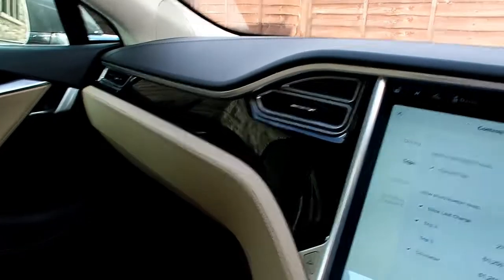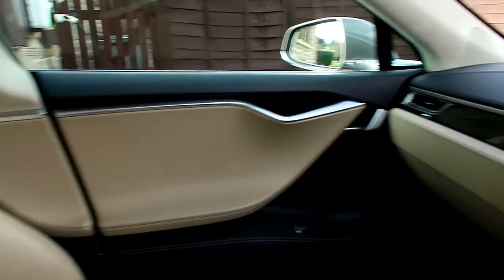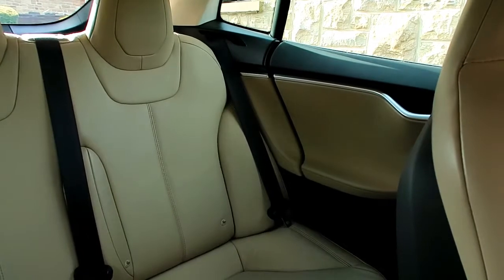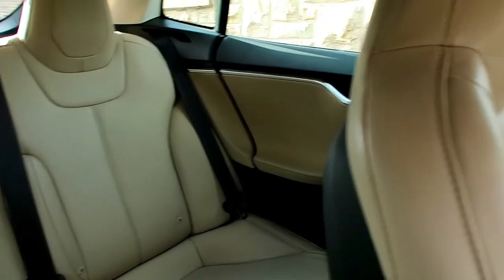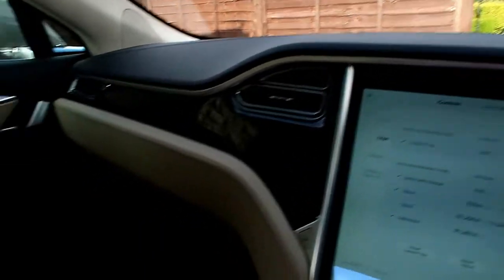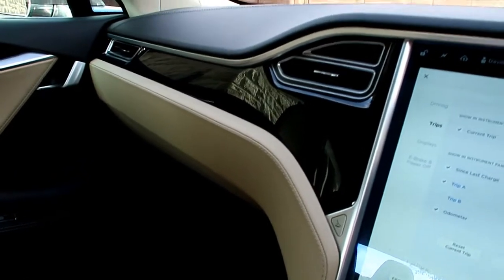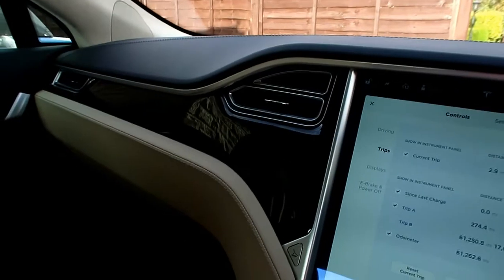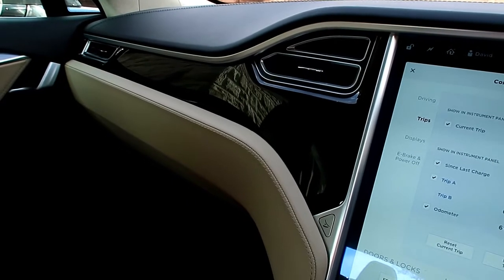Looking at the internal trim — and I've said this before — the fit of all the bits and pieces isn't quite up to the standards one expects from BMW or Mercedes-Benz, and I've had a few squeaks and rattles. I've traced these quite often to little bits of vibration in the trim items, so I've got a few bits of hard rubber and just forced them in to put a bit of tension in so that most of the rattles have gone away. There's the odd squeak, but I can live with that and I think it will improve as Tesla gets better at manufacturing.